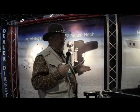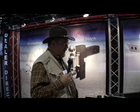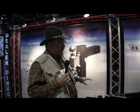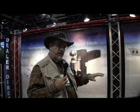That's because it's kind of a pain to hook them up. The RV industry uses them constantly — that's more of the conservative type. When you've got horses out there, you've got an animal with a center of gravity four feet off the ground, swatting flies. You need to control the stability of the trailer. A good weight distributing hitch, besides creating a truss between truck and trailer, distributes weight to all axles, and also controls the sway you can get with a bumper pull trailer.